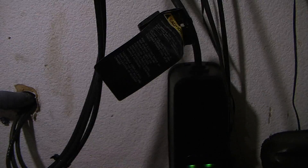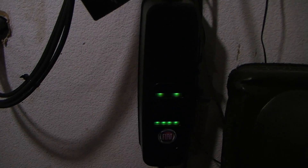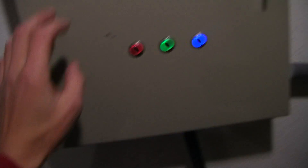I made it for my Fiat 500E. Now if you guys have an electric car or a plug-in hybrid, you're familiar with this level 1 charger that's provided with the car. It puts out about 1500 watts, just plugged into a normal 110 or 120 volt outlet. It provides power to your car and takes about 24 hours to charge from 0 to 100%.